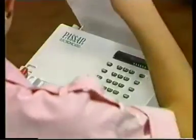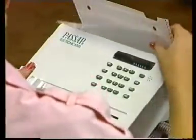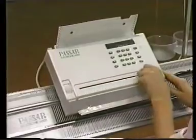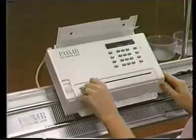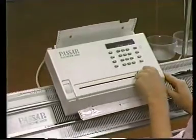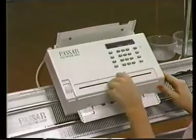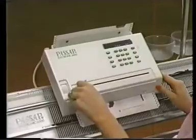To read another pattern drawing, keep turning the transport wheel until the assigned row number of the pattern shows in the cutout window. To read the pattern into the computer, slide the reading knob smoothly and not too fast back and forth. Always slide the reading knob to the very end of the slot. Each time the knob is slid across, the display will indicate that a row has successfully been read by changing the row number on the screen.